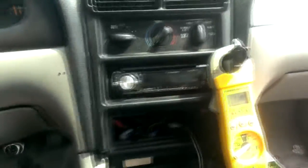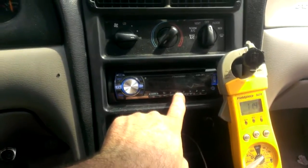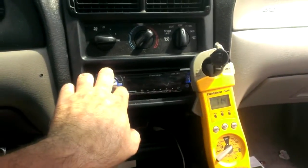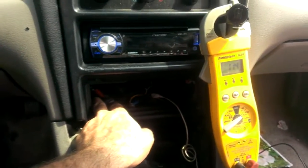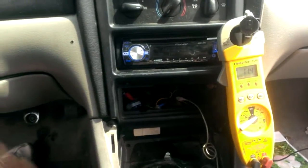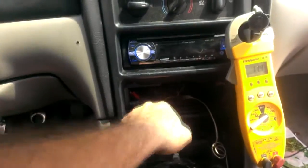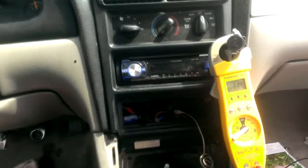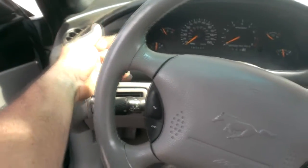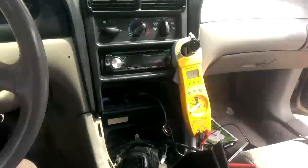Let's see if the memory held. There's my channel — yeah, so it held, even though it dropped down to like six or seven volts. I was surprised it drained down so quick. It could be because the capacitor is rated 50 volts, so it's not a crazy high capacitor — sometimes when the working voltage is way higher than what you're using, you might not get the proper characteristics. But it's normal to have at least double the working voltage, so 50V for a 12-volt system is fine. It works — I just won't be able to have the battery disconnected for probably more than half a minute. That's long enough to pull the battery, drain the system with your lights, hit the brake pedal, and discharge the capacitors in the engine computer to clear it without losing memory in your radio.